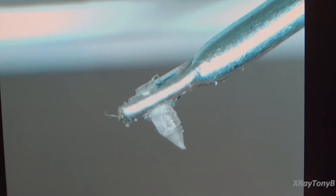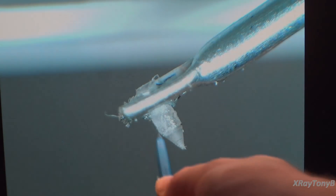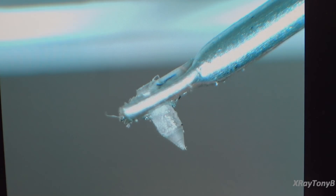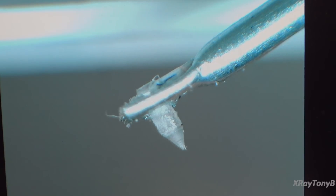This is a nude stylus - you can see how it protrudes all the way through the cantilever. It's still a very low cost one, but this is all one solid piece - this whole thing is diamond - and it's cut into a conical shape. You can see it's just shaped like a cone. If we look at that from a frontal view it'll look just the same as it does from the side view - it's not squished in, it's not elliptical. But for what it is, it's a decent cartridge and a decent stylus. That's what a new one looks like, and you can see the plating on the cantilever hasn't been corroded yet or picked up any dirt from records. As soon as you start playing a lot of records this will start getting all crudded up and you'll have to clean it.